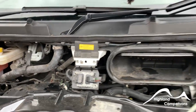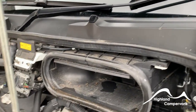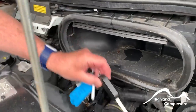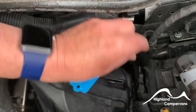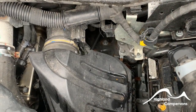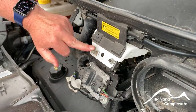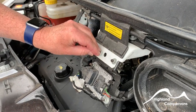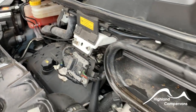If you ever need to give someone a jump start or jump start your own vehicle, take your Fiat key, release it, and insert it here to open the little cover. You'll find a blade to attach the positive jump lead to, and over here there is a ground — an earth or negative. Connect positive here and negative there, then jump start the vehicle.